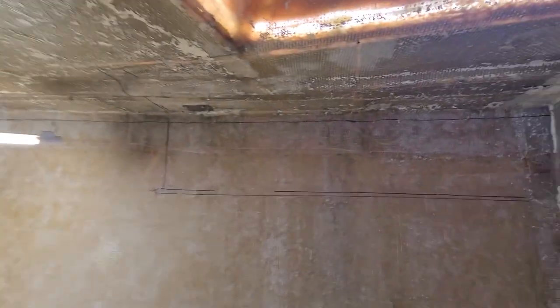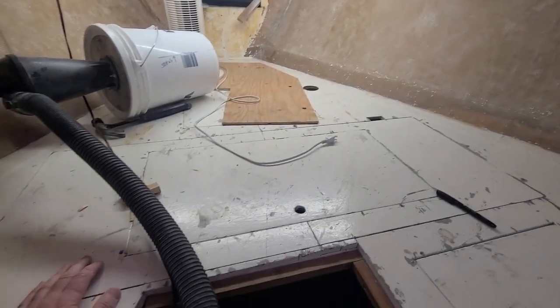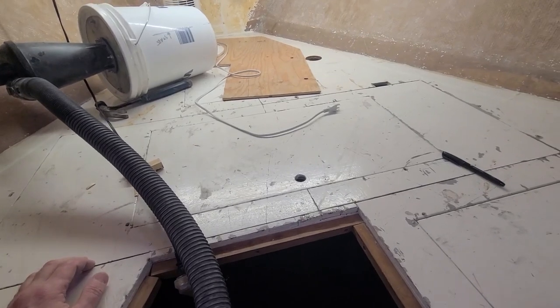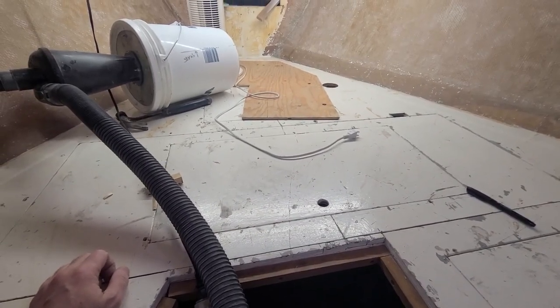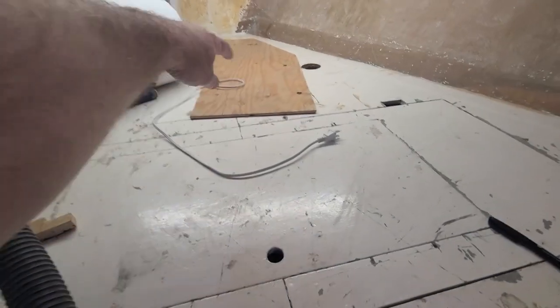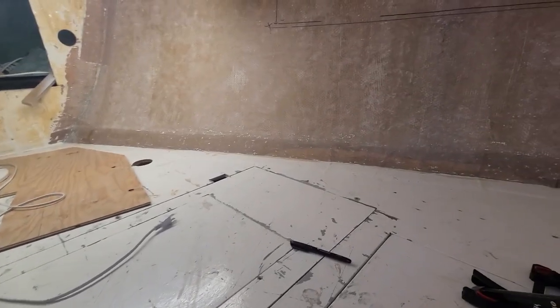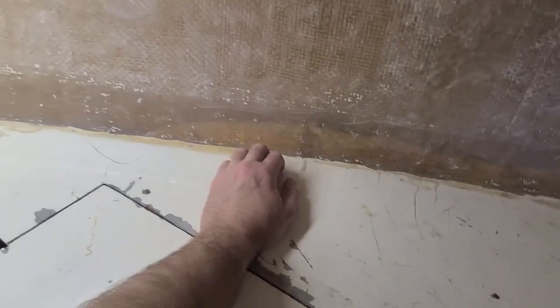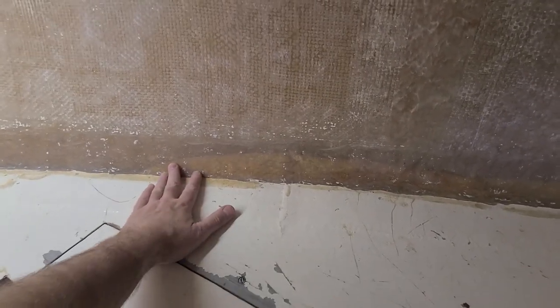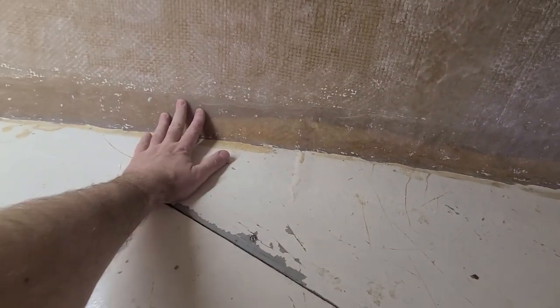So I drew the line on top, and it goes all the way roughly 2 inches from the top right now. And now I have a dilemma here, actually. As I mentioned before, I'm planning to remove the existing water tank, which sits right here, and replace it with a built-in tank. And I want to extend it into another compartment, which is not really used anyway. So the problem is how low I should go with the foam. So let's say this is a tabbing from the deck, the bed surface, to the hull. And ideally, if I'm going to replace this plywood, then I need to tab it to the hull anyway.